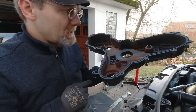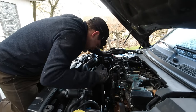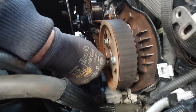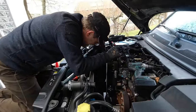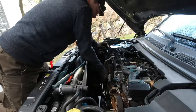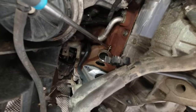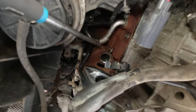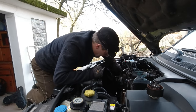This is really nice — we don't have an oil leak. The pin goes nicely in — it's like a six-millimeter pin. Look, this one goes in nicely all the way. Now I hope my plug goes in. If you look in my mirror you can see the hole in the flywheel — it's that little elongated hole. There is my plug now installed. So that's the roller, and now the belt.